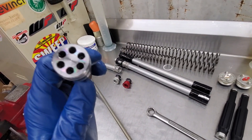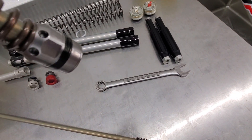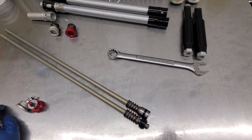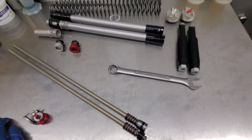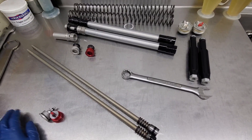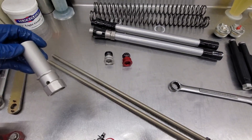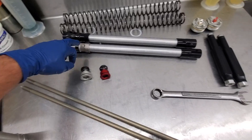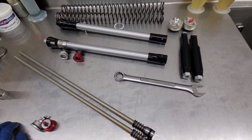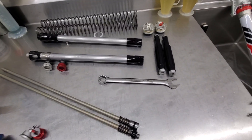Still a standard mechanical piston valve — it has a tapered design; there's no way you'll be able to see inside there. Generally changed, a few nice things done. It'd be cool to get some time and testing on these forks, see how they do stock, and come up with some different valving combos based on the new restricted compression port. I haven't really had too many complaints — just a few guys plonking along out there.